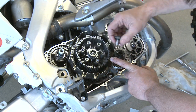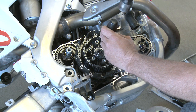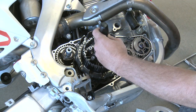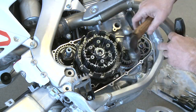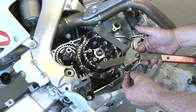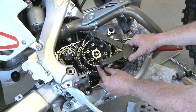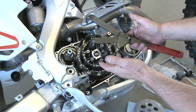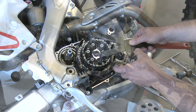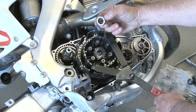Remove the top hat. Stock there's a washer bent over to keep the nut in place if it were to loosen up — you just want to bend the tabs back so they're completely off. Now we're ready to take off the nut. You need a clutch basket tool to hold the inner hub in place. This is a stock Kawasaki tool; Motion Pro has a good one you can use as well. Just use an impact to pop the nut off — comes right off.